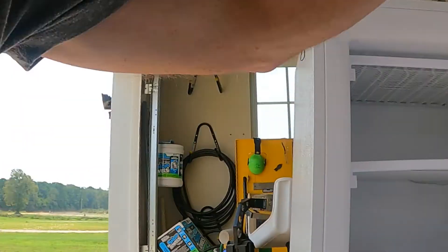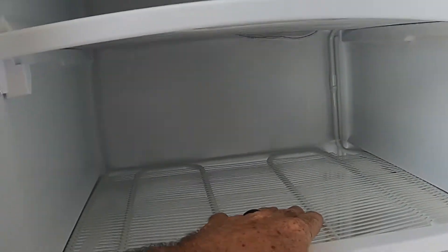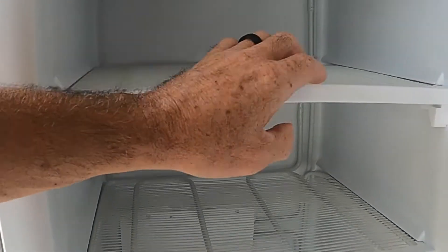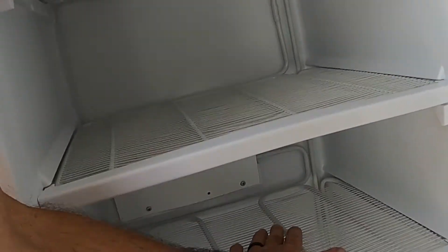So far I like it. One thing on these is you can't pack them too tight — that's what some of the reviews say. I feel like people are packing them too tight so it's not cooling right, not getting enough airflow. It looks like all the refrigerant goes through these lines, so if you start packing too tight you don't get the proper airflow. The shelves are already getting cold, which is interesting — that one's really cold. You just have to be careful not to jam stuff in there.